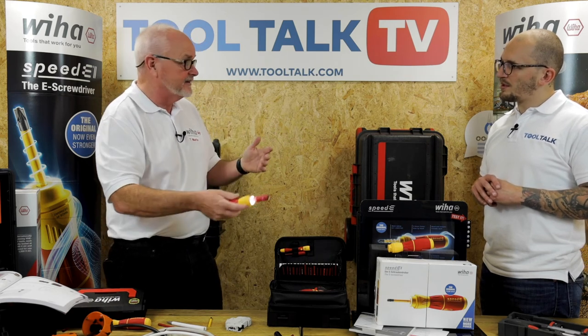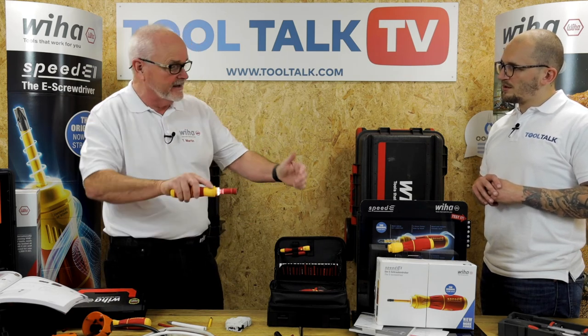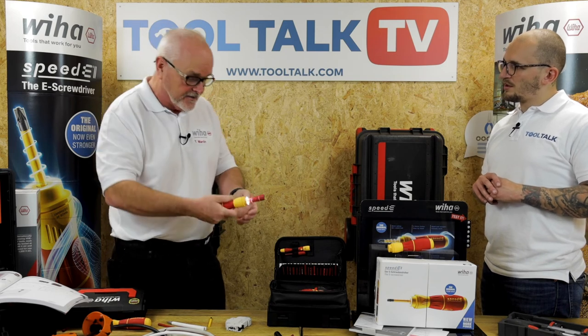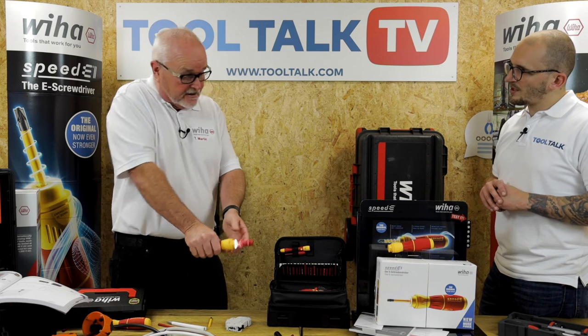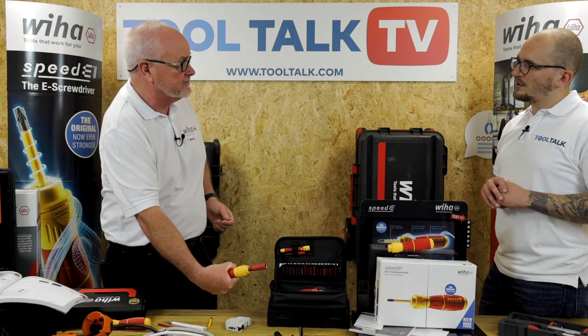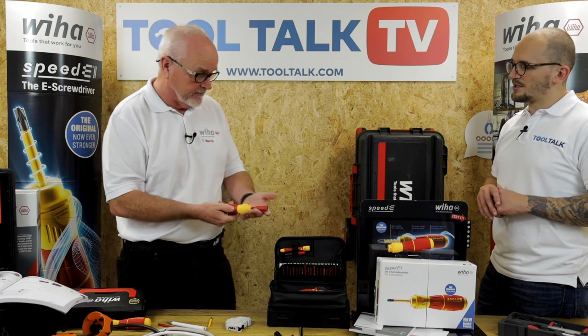Okay. So it's ideal for doing the small panels. Or anything that you need to tighten a nut up with. Because you've got your 1 Newton meter, you can literally go up there and then on the bottom there you can see it does up to 8 Newton meters manually. So you get on there, tighten the final. Okay, happy days. That's what you can do with that.